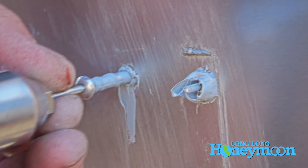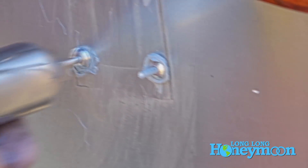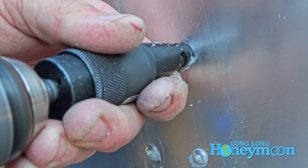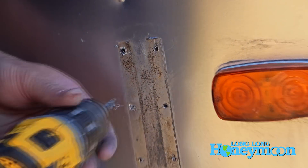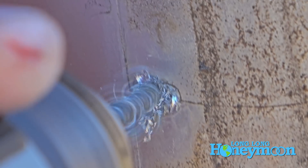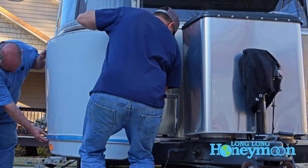When it comes to Olympic rivets, when the rivet pops open it makes a star pattern on the back side of the aluminum, giving a lot more surface area to grab. When it breaks off, you use a rivet shaver to finish the head so it looks like a standard buck rivet - giving you a nice finished look. Once those holes were filled in, we re-established the alignment line and the rock guards are held to the trailer with self-tapping Phillips head screws. It just wraps around the side of the trailer and attaches to the new brackets. A lot of measuring - you have to make sure everything is lined up straight so it pulls through without any stress.